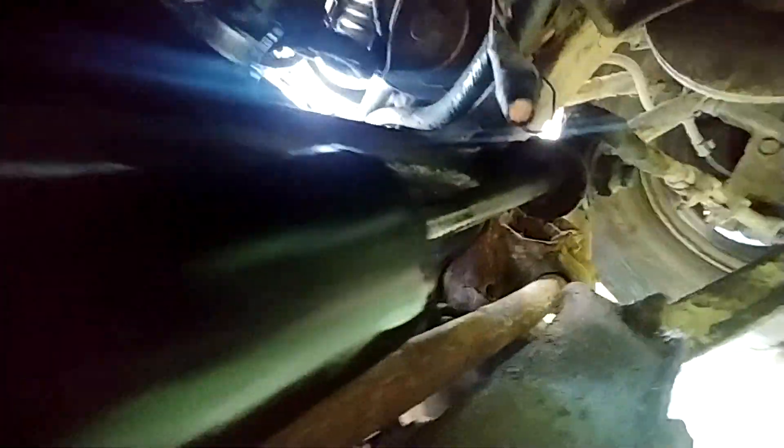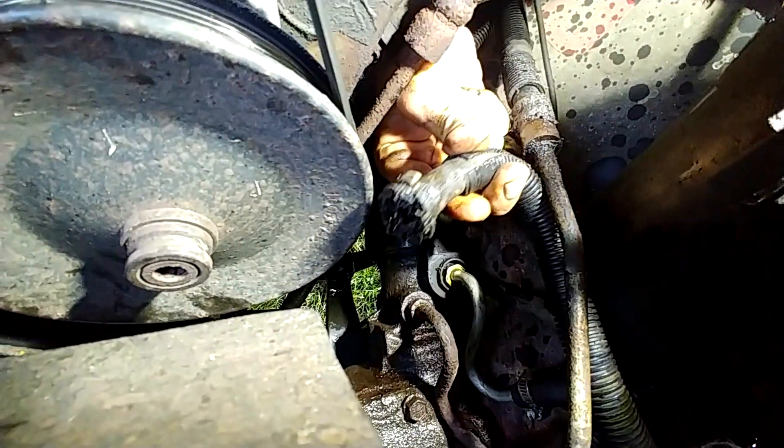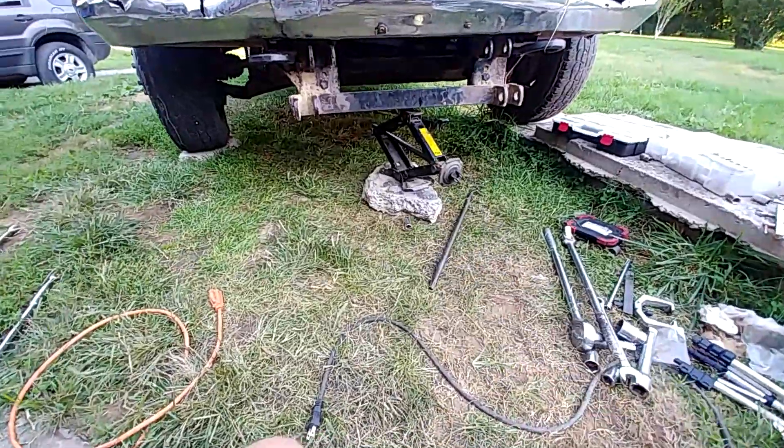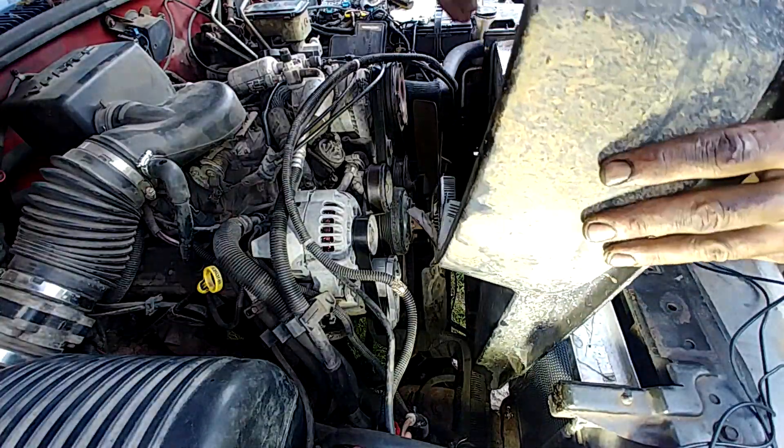Now that it's back together, you can see the steering is smooth — no slap, no play. However, my steering shock absorber is making a little more noise than usual, so she might be next. While running my truck for a couple of seconds revealed yet another surprise: this power steering line busted off. I should be able to cut it back to where the rubber is good and reconnect it to the line with the hose clamp. Putting the fan shroud in and bolting it back down.